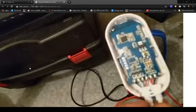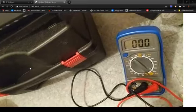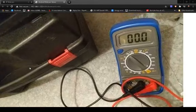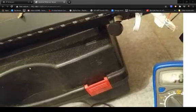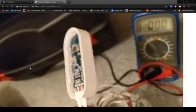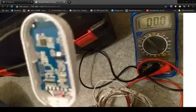Wait there, before we do that, how can we introduce this? It's £7. I can control it with the phone. It's Bluetooth. It's RGB. Problem is it's 12 volts. So I would need a buck converter to change the voltage down from 52 down to 12, then one back out to bump back up to 52. That's impractical. They don't do a 52 volt version of this. I could replace the whole left and right side, but these are not waterproof, the ones that came with it for £7. So that's a no-go. So I still want to use this. I think I'm going to have to order converters to take the voltage down and sort this out, or use offsets. We'll go back to that.